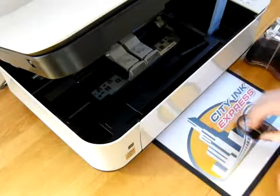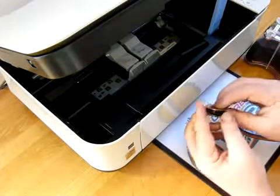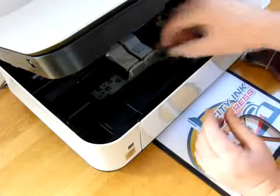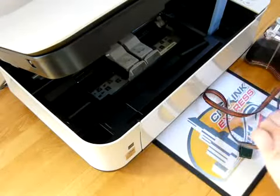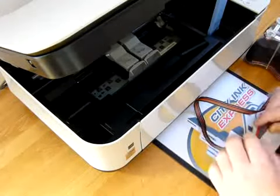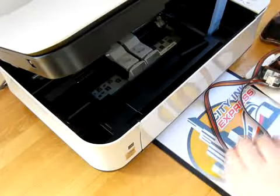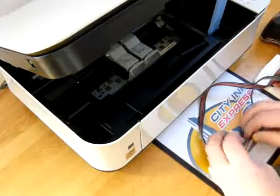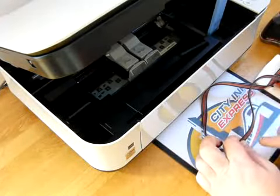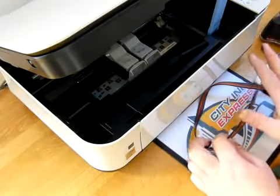So within your accessory pack, you'll have a clamp like this. It's a double bent over clamp that will fit in about there. You need to attach that first to the ink line itself. So the actual placement of this clamp is quite crucial. It needs to be 22.5 centimetres from this point here to here. So get a ruler and measure it.